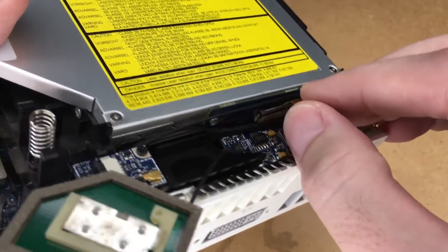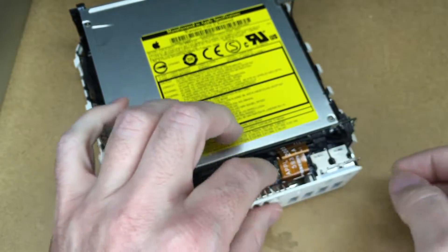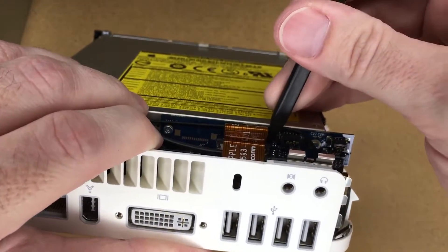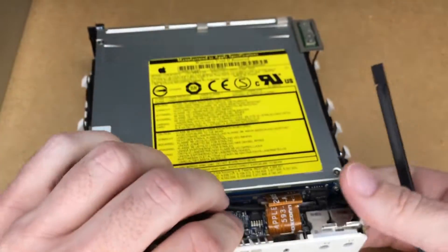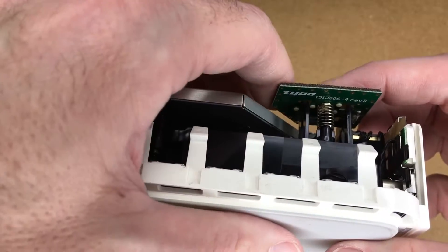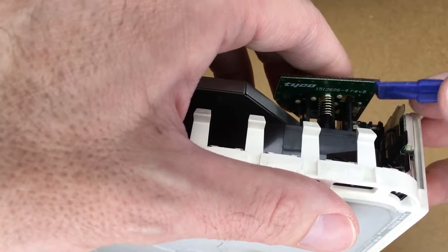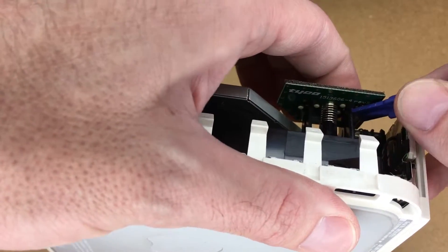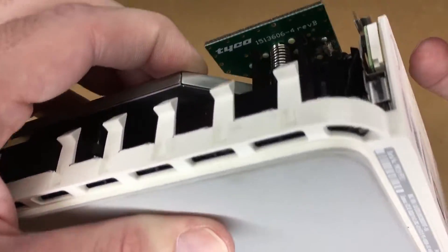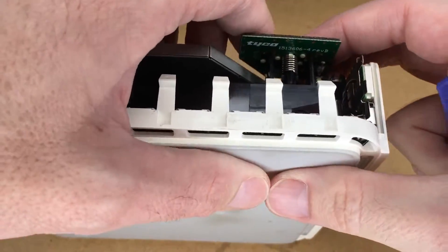Next I'll put this ribbon back in the slot — it should go in super easy. I just set it in there until it bottoms out, then take the spudger tool and press down on both sides. This should all be easy to do; if anything's hard, it's in there wrong. Now we'll go back to the Wi-Fi antenna — I'll stick it on here on the spring, then press it over these clips, trying not to break them. The other one's giving me a little trouble, but I'll push it in just slightly. There's a little pin right down there — I'll give it a little wiggle until it goes in the hole, and now that's on.